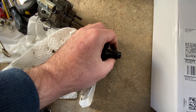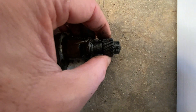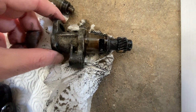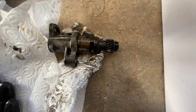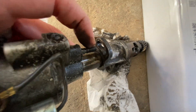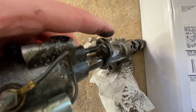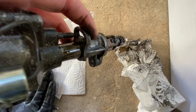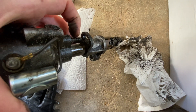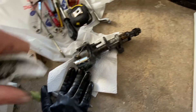That's why I'm taking out the whole thing and repositioning it to where it needs to be. I want to move it so the pin sits exactly halfway — so I have wiggle room to adjust the timing in either direction. I'll show you: this is halfway here. Then I'll put everything back in, set it exactly at my timing mark with the pin centered.